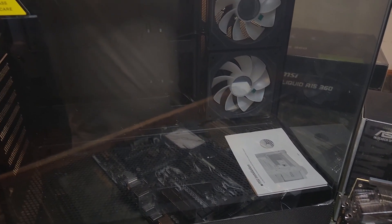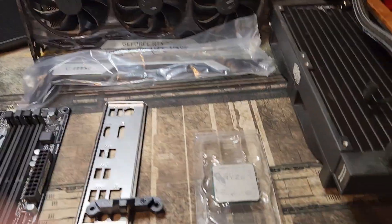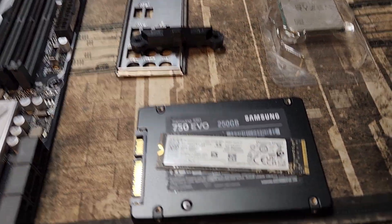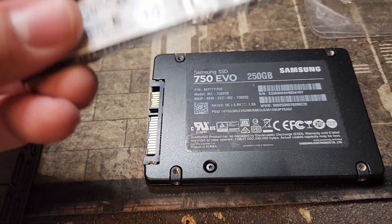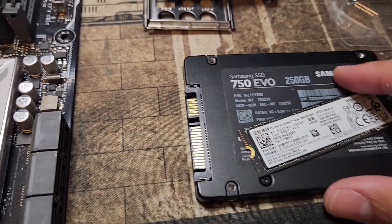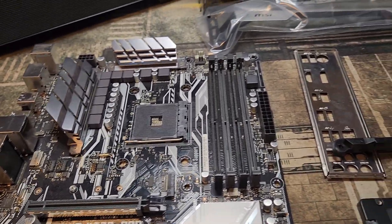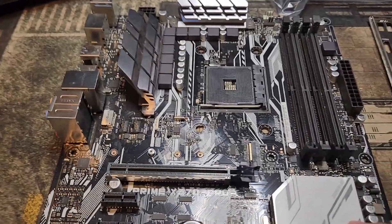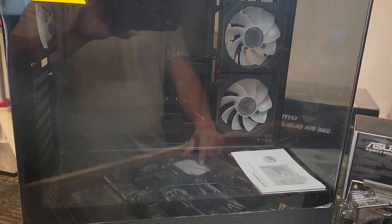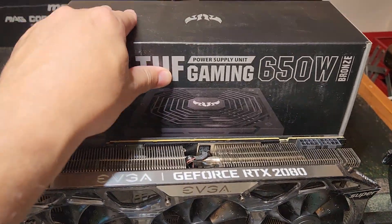I think it'll look good in this Sama case, and with the fans going up top, it'll be a neat-looking build. The only thing we're saving money on is storage — we're going to use a 250 gig paired with a 120, where the 120 is the boot drive and the 250 is for games. One thing to remember: this motherboard does not have any RGB headers, but the Sama case has static RGB you can control from a button, so that's fine since nothing else here has RGB anyway.